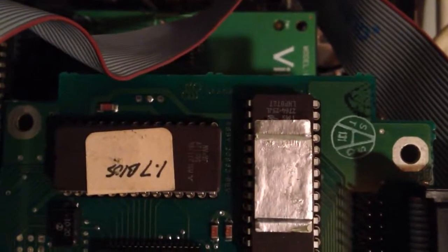Here's a controller for it — you can see it says Seagate right there. I think it's a ST-11, I forget which model. It didn't work until I removed the two jumpers here, and then the onboard BIOS came on and detected the drive, so after that it started working fine.